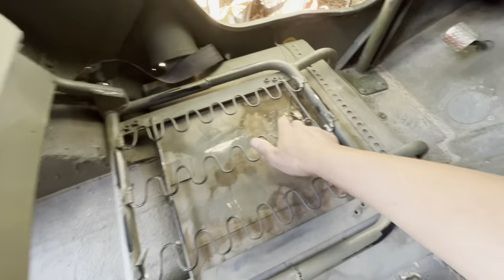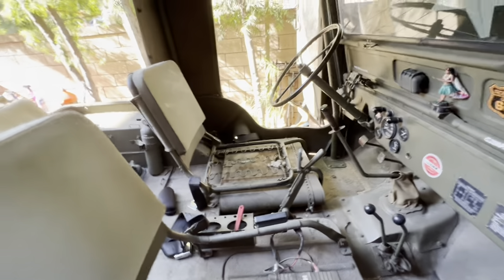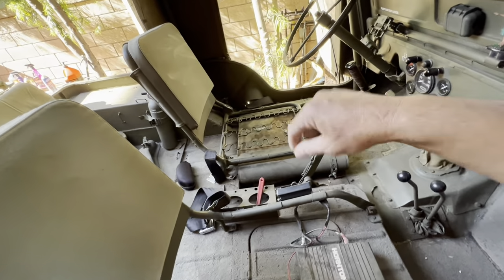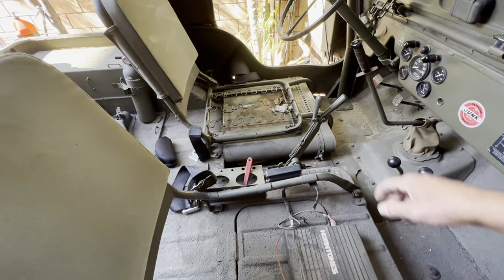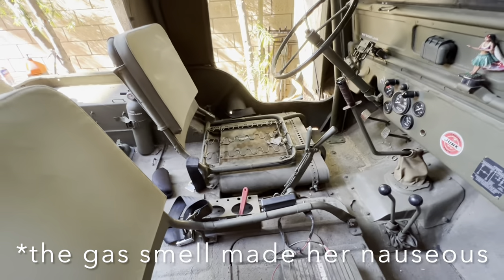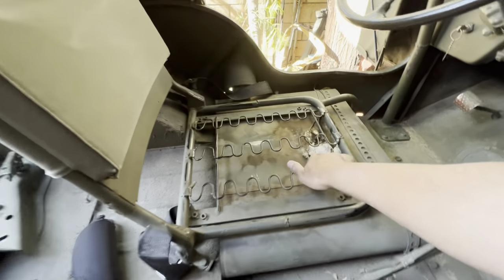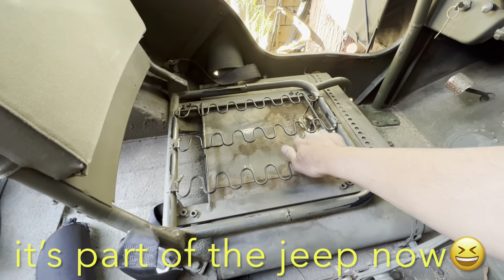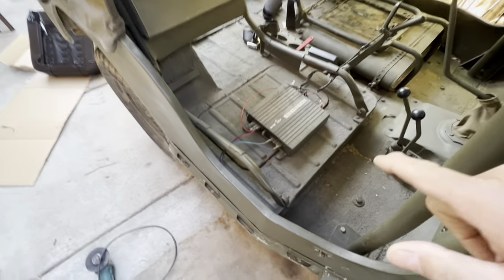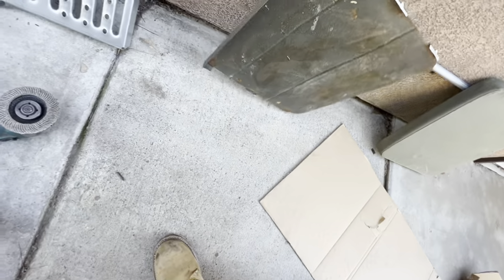You can see where my gas tank was leaking right down the trail — wife was complaining. We ended up hitting a NAPA, got some of that Permatex aviation sealer, kind of like it paints on. I had the gas with a baby wipe trying to soak it up as we were driving there. I ended up pouring that stuff all up on there — kind of petrified the baby wipe on there, so that's part of the vehicle now. Ignore that when the seat's on, you don't see it.